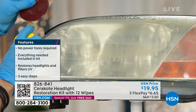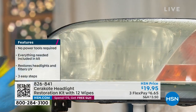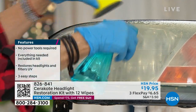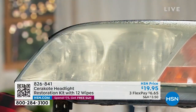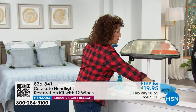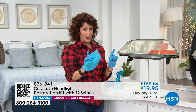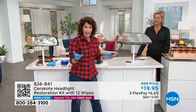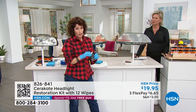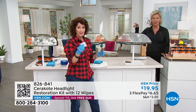I changed out. What you're going to do is about two to three minutes on the red sander, then two to three minutes on the gray. Keep giving yourself some liberal sprays of water. When that's done, you dry it and let it really dry before the last coat. Now we're ready for the final coat — this is so exciting. This is going to last for as long as you have your car.